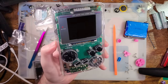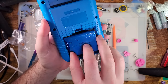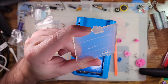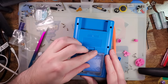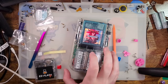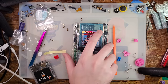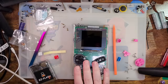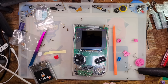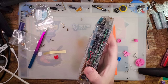Incredible shell. It is designed a bit more OEM-like, so it has ridges in the battery compartment, unlike the Funnyplaying shells which are flat inside and more conducive to battery mods. Even on the battery mod side you have to cut off all the ribs on the battery door and try to get your USB port lined up, which is a lot easier said than done. But as long as you don't want to use it with those battery mods — which I sincerely don't recommend anyway — it's totally fine. I'm diggin' it. I'll throw links to this stuff and to the original build in the description, and links to Retro Game Repair Shop's site if you want to check it out. That's it for me today — I'll catch you all next time.